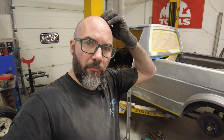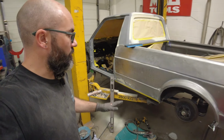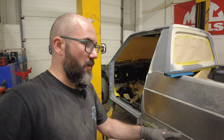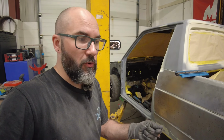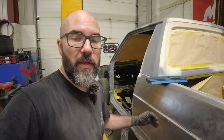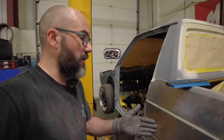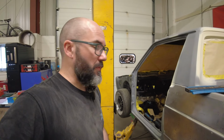Now this side is near on wrapped up. I'll probably wrap up this video now because there's no point in showing you exactly the same on the other side. The reason I'm using the carbon rod for the heat shrinking as well is because it's more precise, local, a lot of heat very quickly, a lot more controllable than a gas torch or a shrink-a-disc. Shrink-a-disc and gas torch are much better in an application where you can get behind the panel and panel beat afterwards. But this little carbon rod on the single-sided spot welder has proved itself very worthwhile in an application like this.